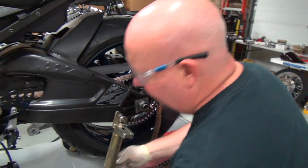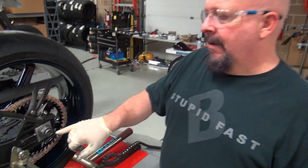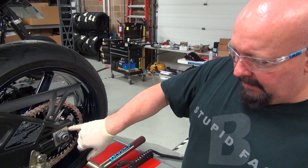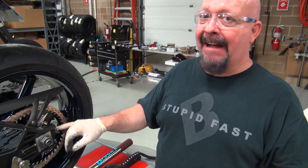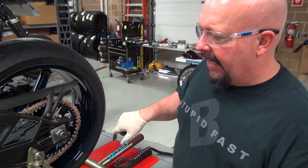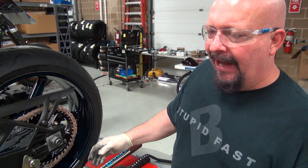Let's see how many links we have to cut out — probably one. I don't think we're going to get it back that far. For every inch that you lengthen your bike, you pick up approximately a tenth of a second in ET in the quarter mile. So for racing, we want this to be back as far as possible. A half inch can make a noticeable difference. But sometimes you're at the mercy of the chain. I'm going to pull it all the way back, see if we can get it adjusted. If not, we're going to be forced to take two links out just to make the chain fit.